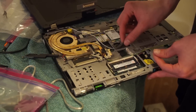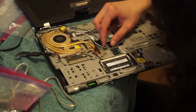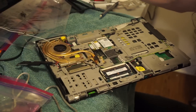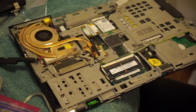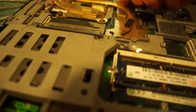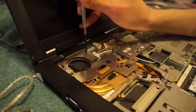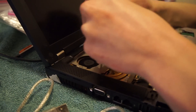Another thing about this model is the speakers are quite a bit better. In fact, there's more than a singular one that faces down. Because of that, it is a little bit more complicated for the wiring. All of them also seem to have WLAN antennas — I haven't found one taken apart that doesn't have the WLAN wires. So there are quite a bit more wires. The X200S with the 1440 by 900 panel doesn't have WLAN, so that isn't that bad for disassembly, but it can be a bit confusing. You also kind of have to disassemble literally every screw you see once you get the keyboard, mousepad, and the third piece of plastic off. That combined with the wiring will take a bit of time.